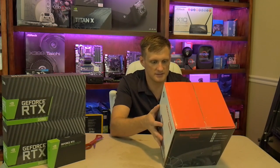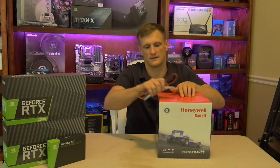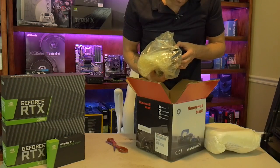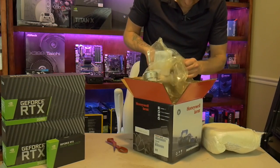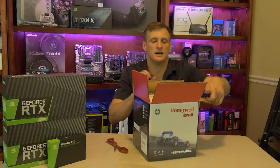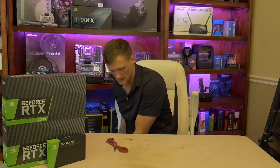Let me verify it's the right one — it doesn't have a recognizable part number on the outside, but the number reads 836026-AR60-M24-B07. It comes pre-installed with an internal wastegate, so I'll have to assemble it this weekend. Once it's together I also have to mount it in the car, which involves dropping the axles due to the location. I'm assuming that's going to take a significant amount of time.